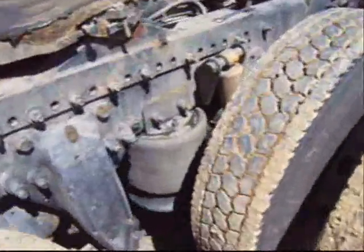I sprayed everything down with soapy water and this is the airbag that's leaking — it's leaking down on the bottom. What happens is the soapy water will foam up underneath there and you can diagnose air leaks that way.